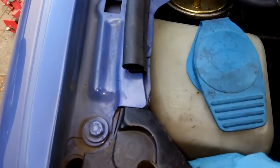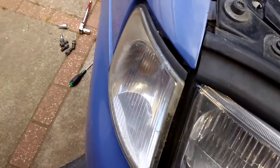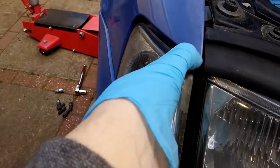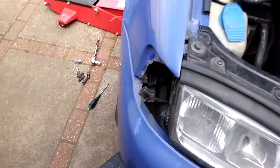So you're going to reach around, push it in and out, and that's going to pop the indicator out. It might be a bit different if you have a slightly newer A3 because it will all be a one-piece headlight, but we need to get that out of the way. Then just pop off the electrical connector at the back and put your indicator to one side.